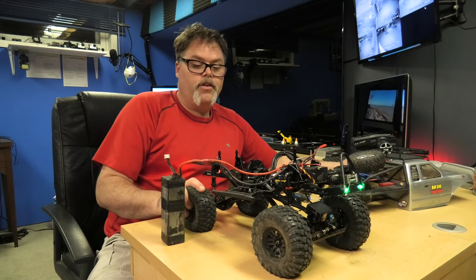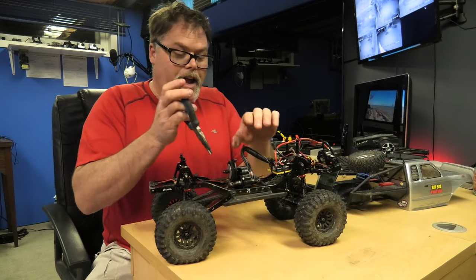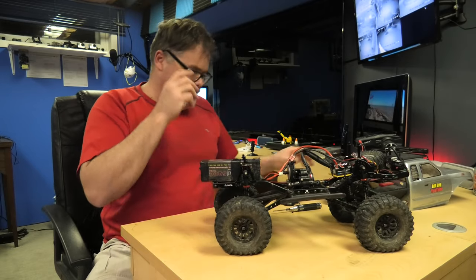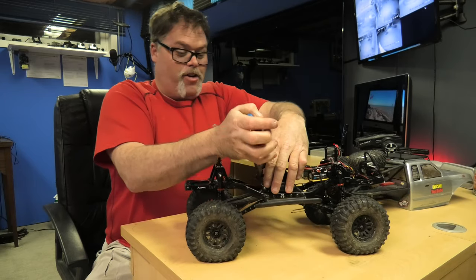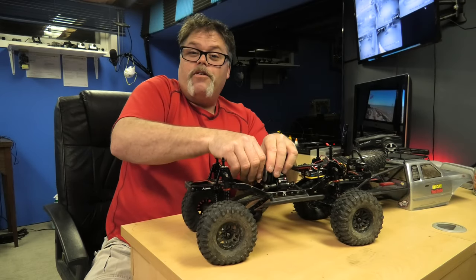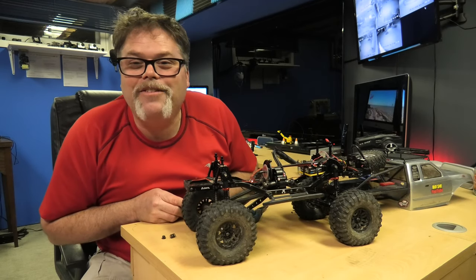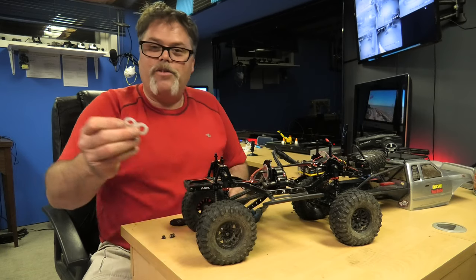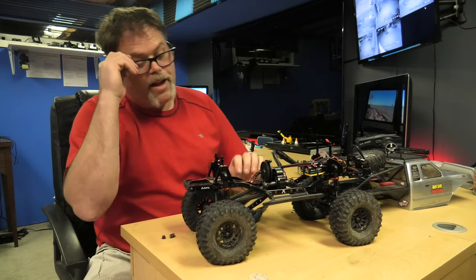I think that's even worse. This thing's just not working - look at the back, look at the traction. I can't get her any tighter. Oh, this thing's a joke. So we're gonna have to pull that transmission apart. I'll put the link below on that transmission so you don't buy it, because it is junk. We'll yank it off and see what we can do to stop it from slipping. That's the only thing that's been wrong with this thing ever since I blew it up that one time, you know, in that video way back when. That's why - I had to fabricate this thing to work because it didn't fit right. I had to put a bearing in it because I didn't have a bushing, and then they used a couple of plastic washers to try to stop it from slipping. So that's what's going on.